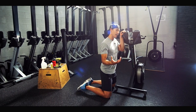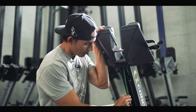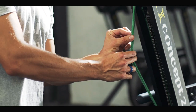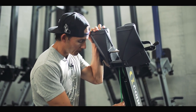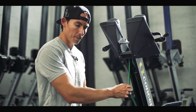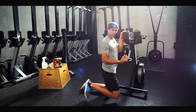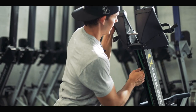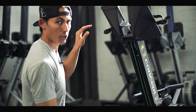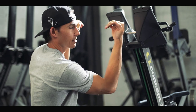If you're having an issue with the handle not retracting, there's a pretty easy solution and it all starts with the bungee. This bungee system is pretty resilient. There may be a little fuzziness on it — that's fine and to be expected. But if you get down here and you see the green housing is torn and you can see the elastic underneath, then you need to replace the bungee. Otherwise it's usually still pretty good. However, if your handle is not returning as crisply as it once was, you're going to get into the attachments of the bungee and just tighten them down. The bungee attaches at two points — on the left it's a hook that faces away from us, and on the right it's a hook that faces towards us.